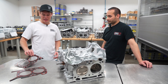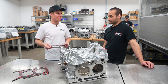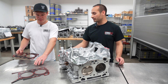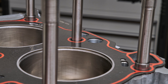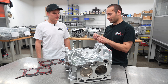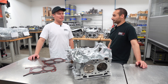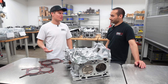Let's talk about the FireLock head gaskets. You've probably seen these before on our EJ short blocks — these are the FA version. We separate the cylinder sealing from the cooling and oil sealing. It's a fiber composite gasket that seals the coolant and oil, and then there's a stainless steel ring that sits in the groove of the block and seals the cylinder. You get the best of both worlds as far as gasket materials. We've tested on our EJs and made 1,200 horsepower with this setup without any head gasket issues — so with the IEG FireLock system, that's really a thing of the past.